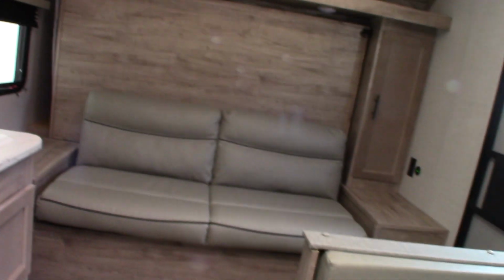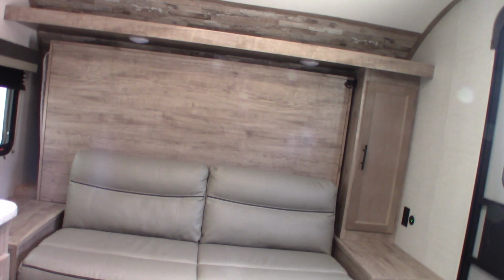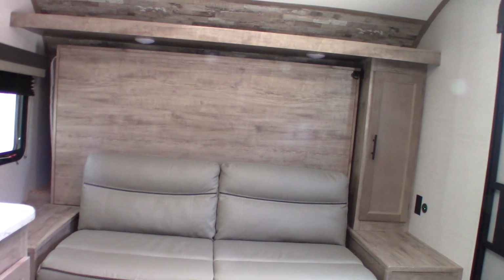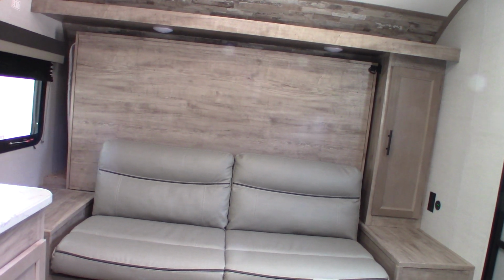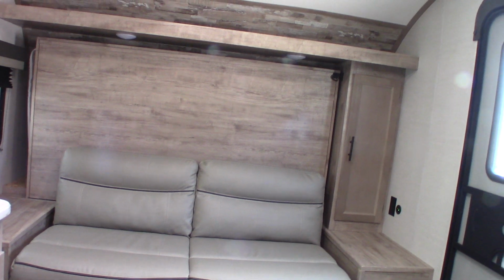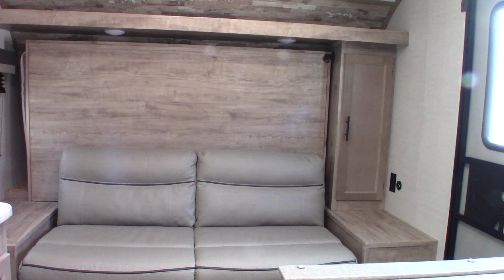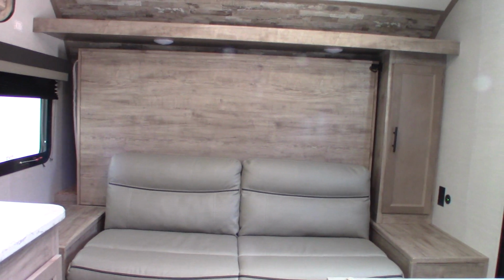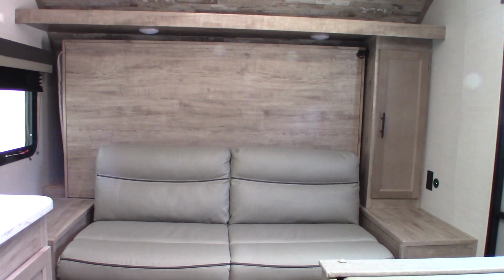So, I want to thank you for purchasing your trailer here at National RV Detroit. Make sure you inspect your roof and all this. Any place you see sealant from the factory, you inspect. Make sure there's no leaks up there. Make sure that there's no damage caused by low branches or road debris up there. Just to stay ahead of any potential problems, just be very careful, okay? But it should be part of your regular maintenance. People generally don't inspect their roof enough, so keep after that.